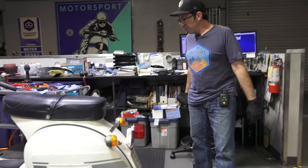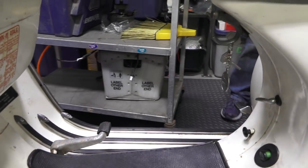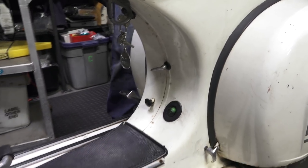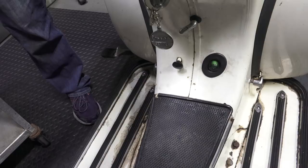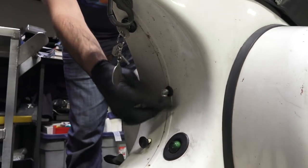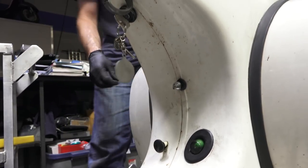Now I have it and I've put a little bit of love into it. Replaced the oil sight glass — you can see the floorboards got some oil in it. That's the plastic oil sight glass that threads into the metal oil tank for the oil injection system. If you're not familiar with two-strokes, it meters the two-stroke oil into the carburetor so you don't have to add oil to the gasoline. I replaced the fuel line and the sight glass. The fuel tap was already replaced. This '73 still has the old style metal fuel tap: C is closed/off, that's run, and there's reserve — giving you the last two liters or half gallon of gas in the tank.